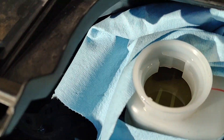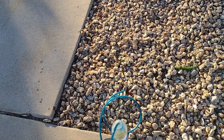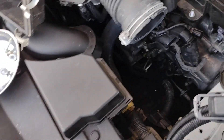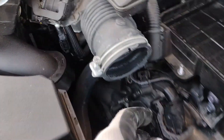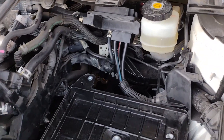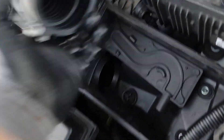About a week or two prior to this process, I noticed the clutch pedal was getting a lot softer — I was losing pressure. Then a few days prior, I had problems shifting into reverse, and a few days later it started having the same problem with second gear. I realized the car only had 22,000 miles but was 4 years old — the fluid was 4 years old. That's definitely a maintenance item I neglected, so make sure you don't. It's something you're supposed to do every two years.